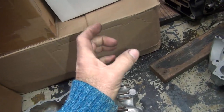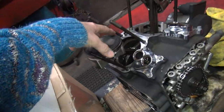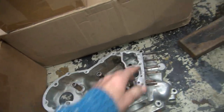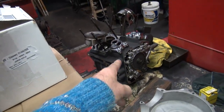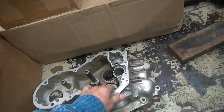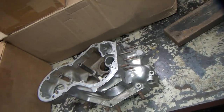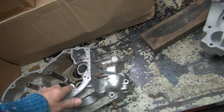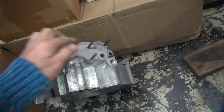If you blow your oil plug off your tank because you have a bad motor, the reason it's doing that is because you have hundreds of pounds of crankcase pressure because your rings suck. Every time the cylinder fires, blow-by goes down and pressurizes your crankcase, and then the breather doesn't work correctly and you blow the tank cap off. A lot of new Twin Cams have that issue because they have a poor venting system - it's almost non-existent. When you have a motor that doesn't have a lot of blow-by you don't have problems with your oil tank blowing caps off, and a lot of oiling issues go away too.